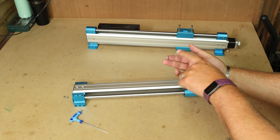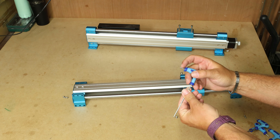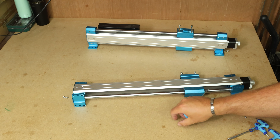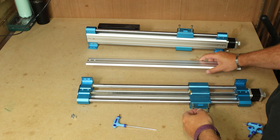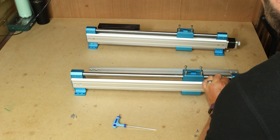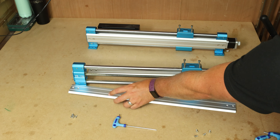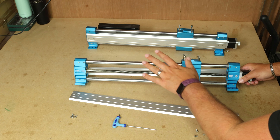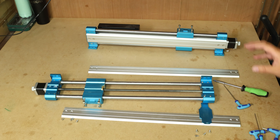I've just taken the bolts out for the first dust guard. These machines have started using thread lock on the bolts, so be careful. Allen keys have a rounded end and a flat end — make sure you're using the flatter end, otherwise the rounded end can round the screws off. They can be tight; if you're starting to struggle, stop and don't round it off. This one was really stuck — and I was right, we can see the white thread glue residue on the underside of each hole.